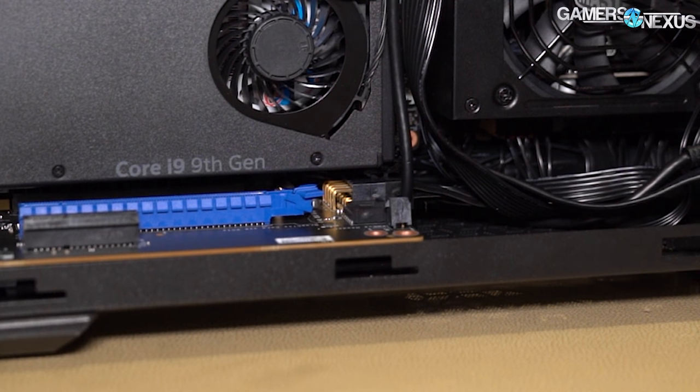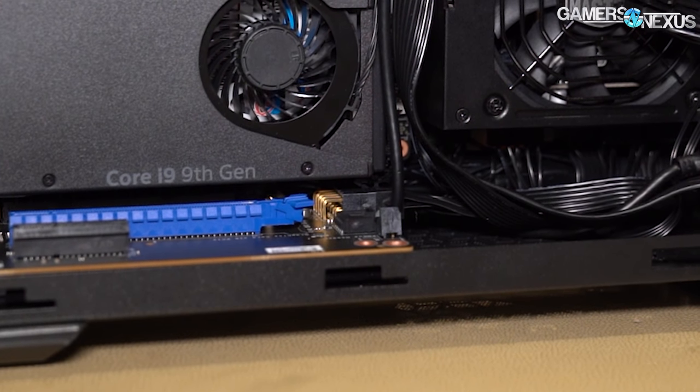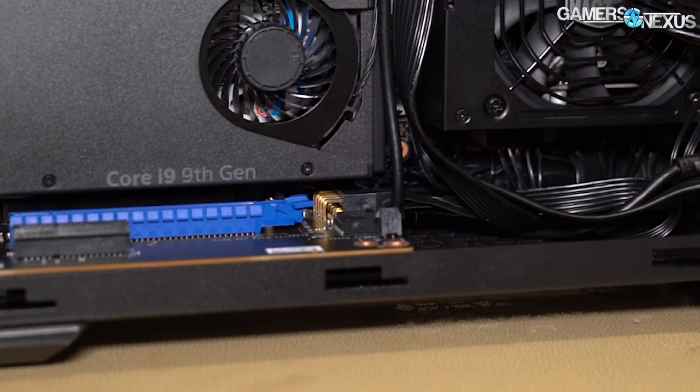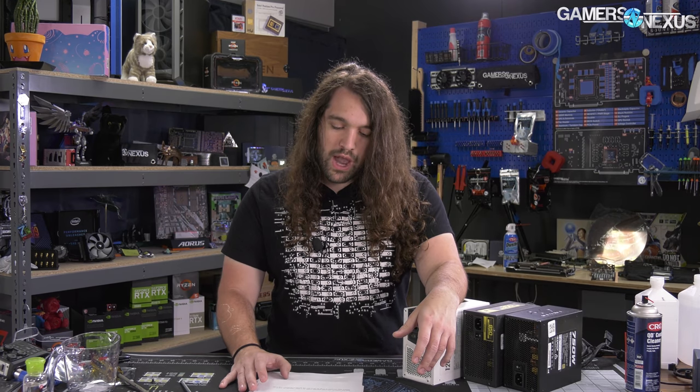If you look closely at the footage we took at CES, there is a smaller power connector for the motherboard—not some proprietary special connector, but the start of the 12V0 spec rolling out to the public. The 24-pin ATX cable is invariably the largest and most difficult cable to work with in a desktop, and it governs the size of things like cable cutouts in nearly every PC case. So there could be knock-on effects later where cases change the size of their cutouts, and the panel depth on the rear side of the motherboard won't need to account for as many cables.